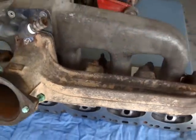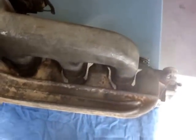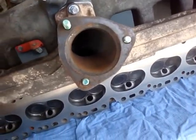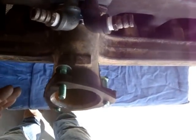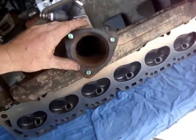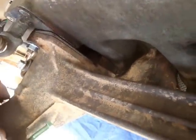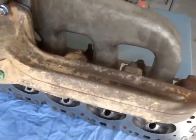The exhaust manifold is not your regular manifold — it's actually off of a late 60s, early 70s Ford. They made them for dump trucks, one-ton trucks, heavier-duty operations. They're kind of rare, but the advantage is it has a two-and-a-half-inch dump right here. The regular common manifold came off at about 45 degrees and was two inches, so by cross-sectional area you get quite a bit more flow out of this two-and-a-half-inch pipe. Some say they actually flow better than headers. You also don't have a flapper heat riser valve to get in the way of flow like you do with the regular manifolds.